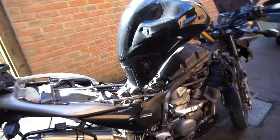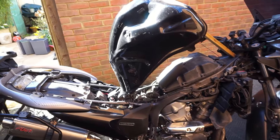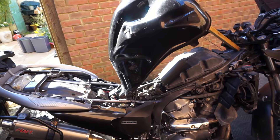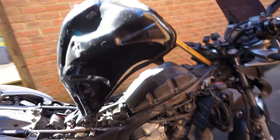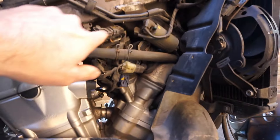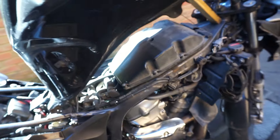Stage one: put her up in service mode, side panels off, tank up. I'm suspecting a vacuum line leak — other people online have had almost identical symptoms and that's what it was for them. The lines connect the two throttle bodies deep in here, so I'm going to try taking the airbox out of the way to see if I can get access from the top. Not looking simple, but let's give it a go.